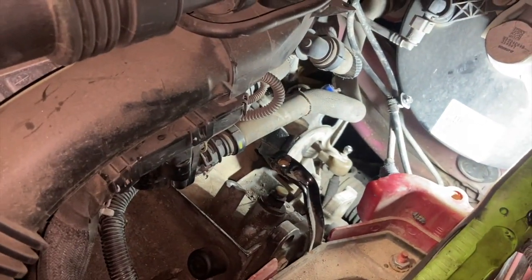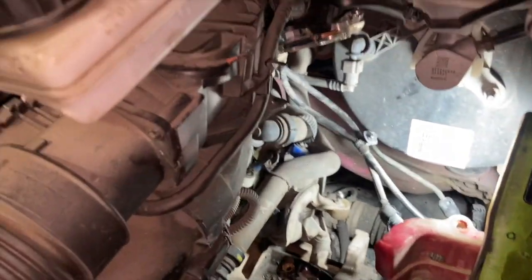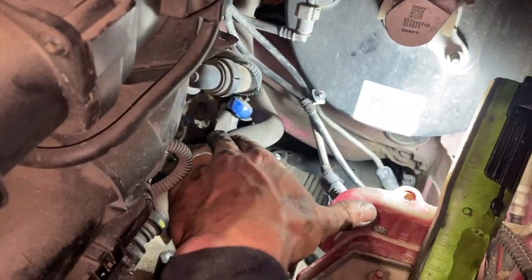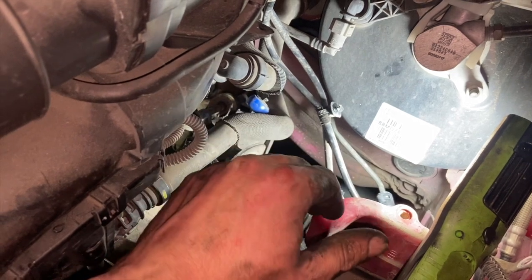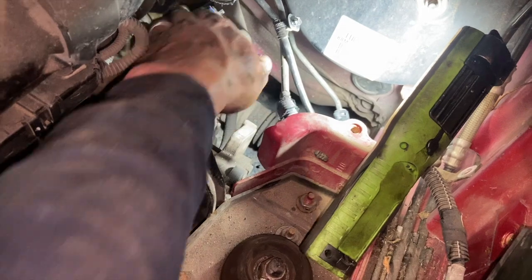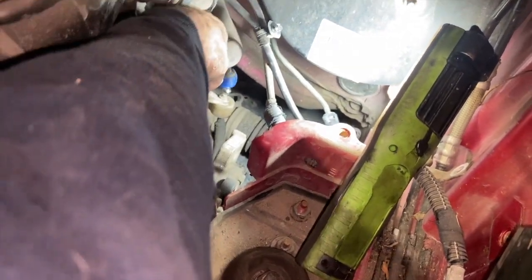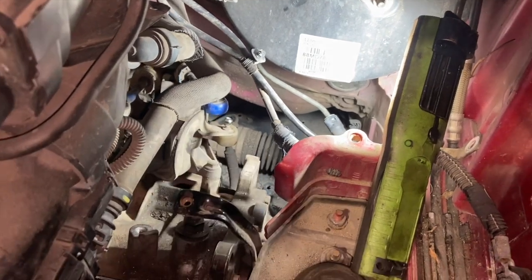Before we can finish off underneath, I've had to come back up just to put that starter motor bolt in, so we can line them all up evenly. While we are back on top, we push the gear cables back in, and all you do is push the second bit into the slot. It's fairly easy to slot in, and you'll hear it click home. Then once it's home, you simply push your cables on straight, and you'll hear them pop into place.